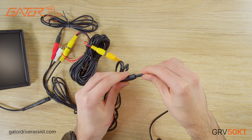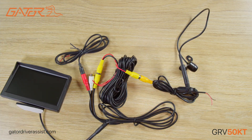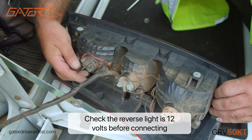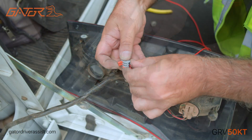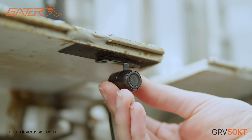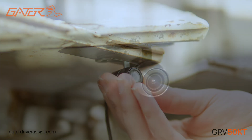Please check the product manual for more detailed instructions on how to install this product into your vehicle. In order to have the LCD display automatically switch into reverse mode with parking guidelines when you put the car in reverse, you will need to connect the wires on the camera harness to the reverse light of your vehicle. You can mount the reverse camera anywhere on the rear of the vehicle using the included adhesive and screws where you'll get the best view.